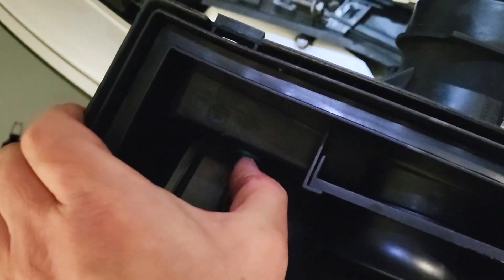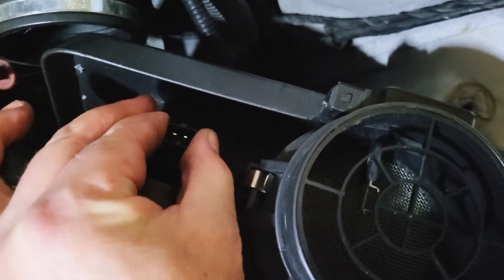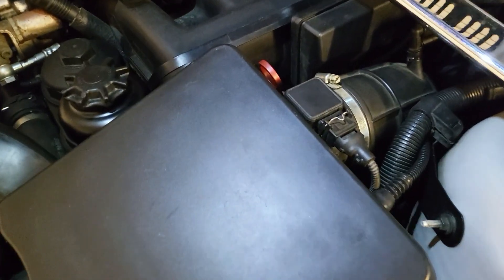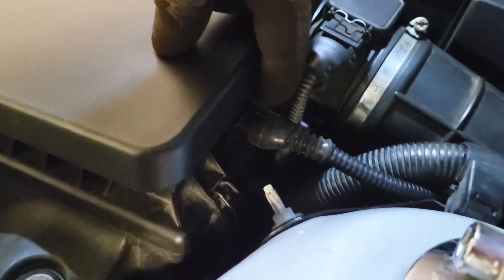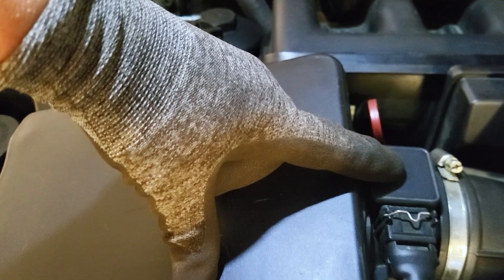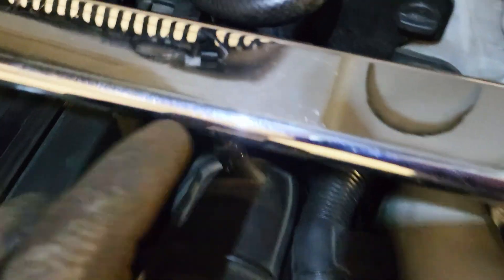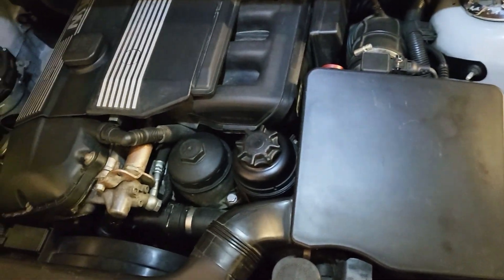After some struggle, the sensor will be located here. I have to put some insulating tape there to make it tight because I don't want the sensor wobbling. Now it's tight enough — it's not moving around, just has some normal spinning, but it's secure. And here we have the intake air temperature sensor right beside the mass airflow sensor behind the air filter. The extension is routed in the back of the engine, so the whole look is quite OEM and I wouldn't doubt about it.